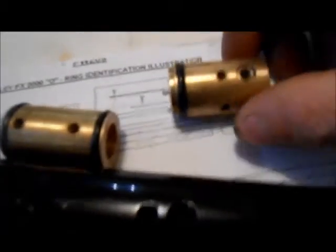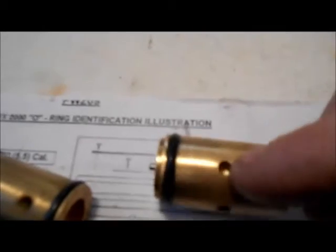They'll only go in one way. If you study the cylinder, they will only go in one way. Obviously the little one with the little white plastic cap in there is for your pressure gauge — that will sit on these first two with the pressure gauge at this end. There's one hole in here which isn't going right down — it's offset from the others, just a smaller one. Remember that your stock actually screws into that, so those two there have to line up with these two here. Put these in real slowly because you've got to get everything lined up when you push them back in.